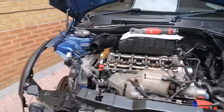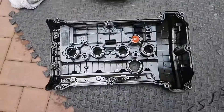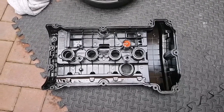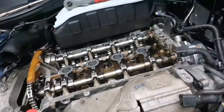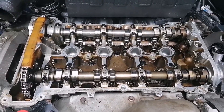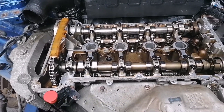The rocker cover is off. There's the old rocker cover gaskets in there — actually it's a new one, only about 12 months old from when it was rebuilt. No problems taking it off, really easy job. Looking at the cams and followers, everything looks fine — there's no discoloration on them.